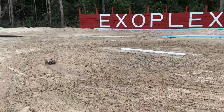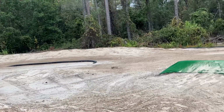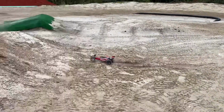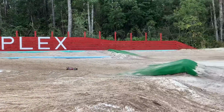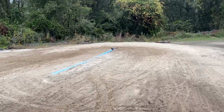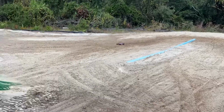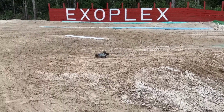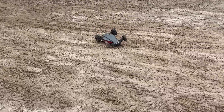Still coming up a little short. Yep, definitely coming up a bit short. So apparently the 12 turn Titan has got timing on it. And that's going to be the biggest difference between those 2 motors as far as the RPMs go. And I'm referring to, wow, that almost got it right there. I'm referring to the 12 turn Trailmaster being 0 timing.